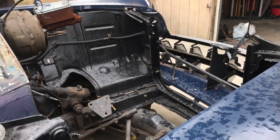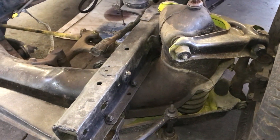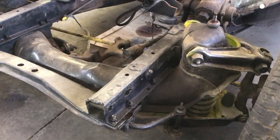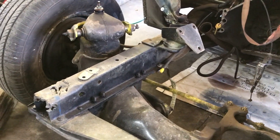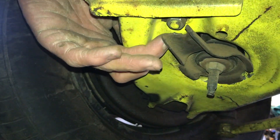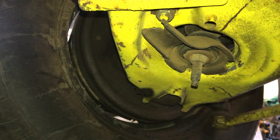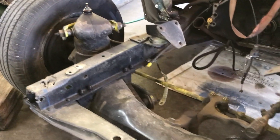This car from the factory had a pretty decent front end — it was the same front end used on the original Corvettes from 1953 up until the Gen 2 Corvettes. But the passenger side shock mount on the A-arm broke and was dangling. Plus it had old drum brakes, which is not good for the power plant I want to put in this thing. The passenger side brake cylinder was leaking, so when you hit the brakes you went lurching into oncoming traffic.